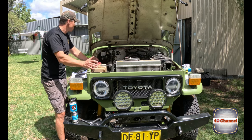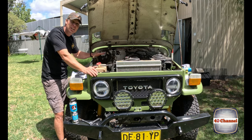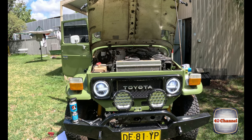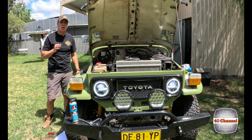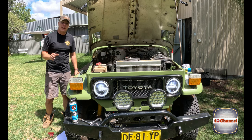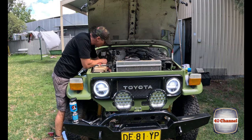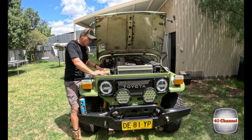I'm going to check my voltage to make sure we're not overcharging, and check my ballast and resistor to make sure the ohms are within spec as per the instructions. The vehicle starts up first time pretty much every time — it's nice warm weather. In cold winters here in Bathurst it does struggle a little bit, but still no issues firing it up. We've got 14.2 volts — so everything's tested and we've got the new coil in.